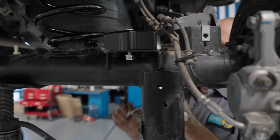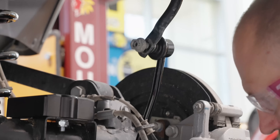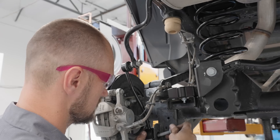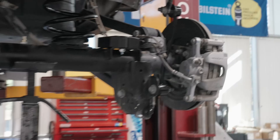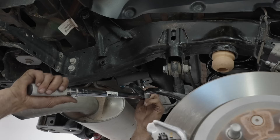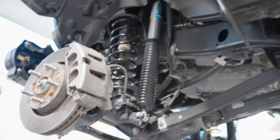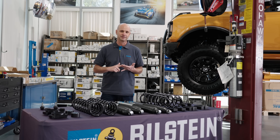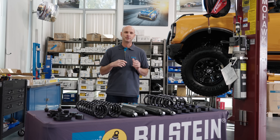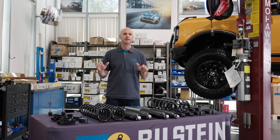The other reason why we're sticking with 1.5-inch lift is very important, and that's suspension geometry. At 1.5 inches of lift, your suspension geometry is virtually unchanged, meaning your track width is only slightly varied, and your caster numbers can be aligned. So with the 1.5-inch lift, you won't need aftermarket control arms, track bars, track bar relocation solutions, or anything like that. You're basically looking at replacing the springs, the shocks, and the sway bar links — three items — and with those three items, you'll be able to get the 1.5-inch lift you want with the 35s and keep a lot of the OEM components.